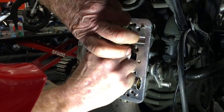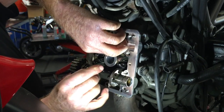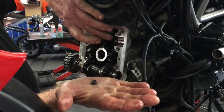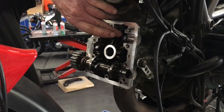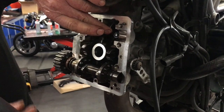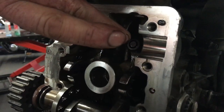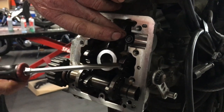So we have an opening shim which is awfully small and difficult. That's an opening shim which fits on top of the valve, and the closing one, as you can see, is there. Have you got a light for that? Can you get in there to see that at all? Yeah, it's quite clear. So that's the actual closing shim and the valves are operated thus.